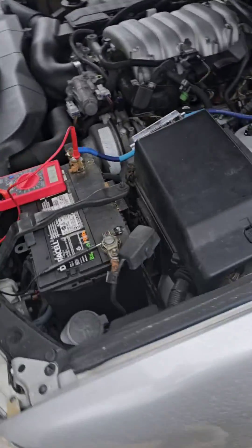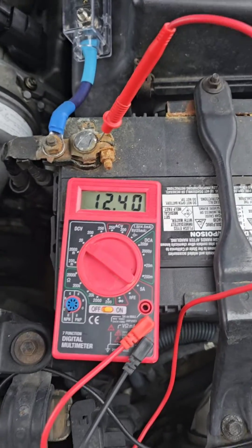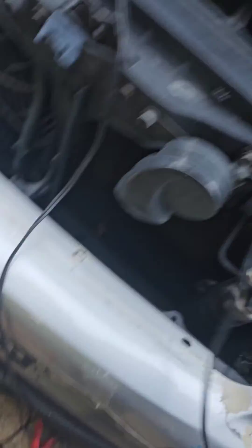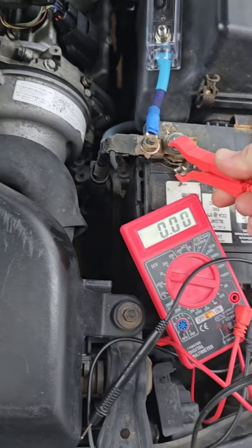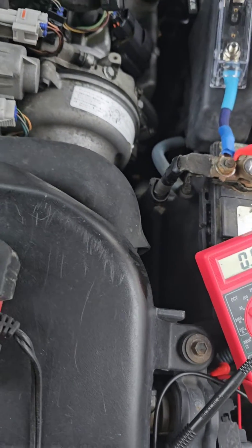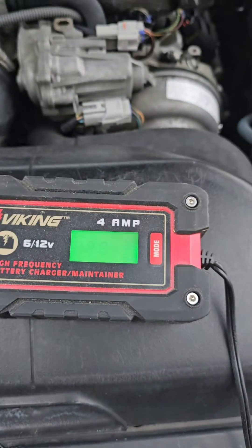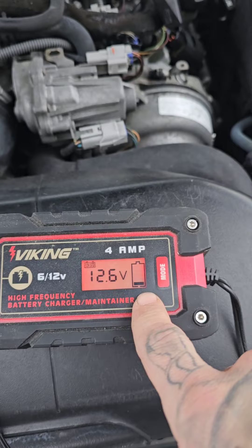Car's off. I'm going to come back here. The voltage is showing we're at 12.4, but it's kind of going down. So let's get the battery charger on it real quick. There we go — 12.2. It's going to pop up here, and it's charging.